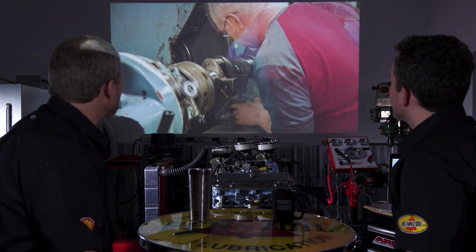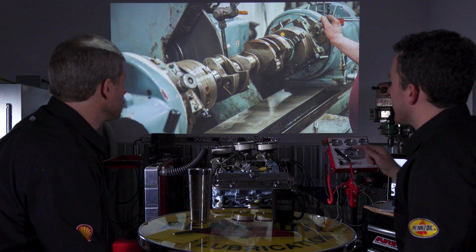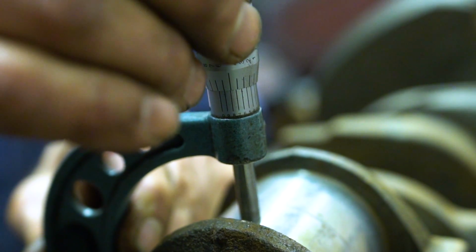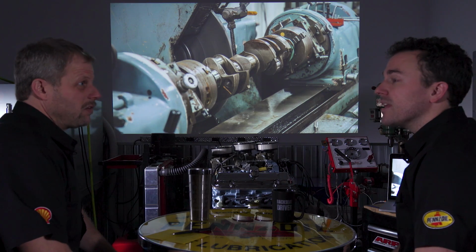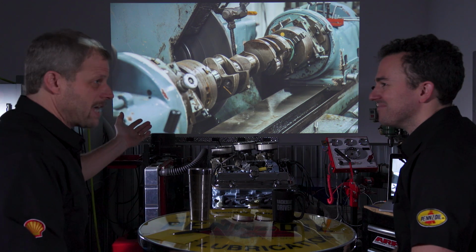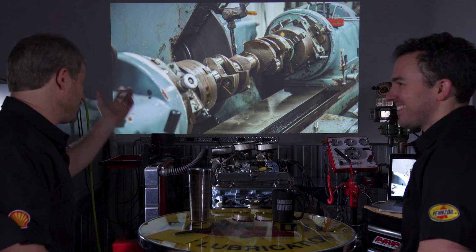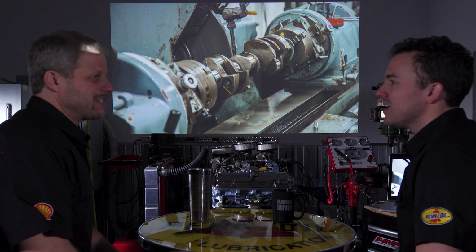But this was when we took this to Thurlby, and they don't do crank grinding there, but essentially Mark measured it and decided this isn't going to work. Yep. We can't. And there was some wonkiness, if you remember, with this. I think it was one of the main bearings was a different size than all the rest. Oh, that's right. One rod was turned, and it was kind of like a head scratcher, because if you're going to go through the task of putting this on the lathe to turn it, you might as well turn them all. Right. Because once the setup is done, turning them all is nothing in time relative to the setup. So yeah, one was 40, one was 30, it was like a 10 and a 20 or somewhere in that range.